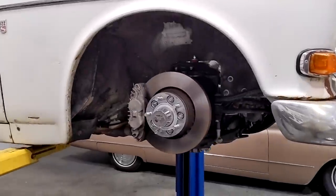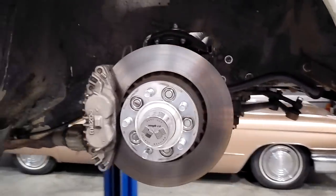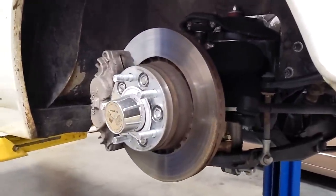Here's that front disc setup — this is off of, I think, an FB RX-7, feel free to correct me. With a Volvo 740 disc — it's actually a popular swap for 240s and 740s, that kind of thing. It fit well on this car and lets me get four-wheel disc all the way around. The front calipers on these are getting really hard to find these days, same with the discs. The disc is made into the hub originally, so this setup allows me to run a separate disc with a caliper I can get pads and replacement calipers for anywhere — including performance calipers, which you can't get with the standard 122 caliper. It's on EBC Greenstuffs now, which is really nice. I do like to drive the car and take it around some mountains, so that helps a lot.